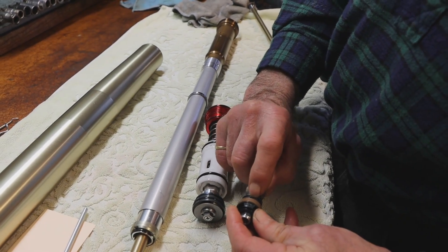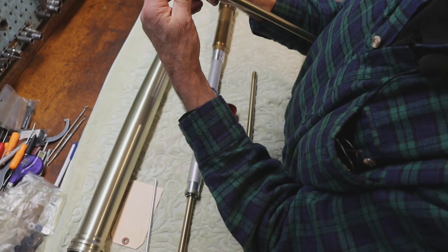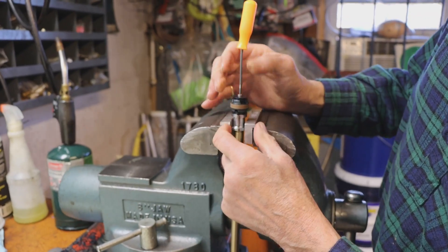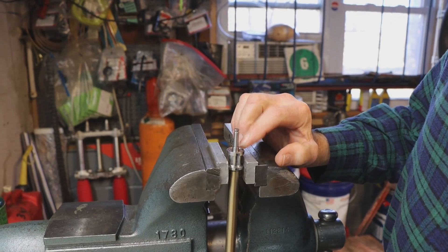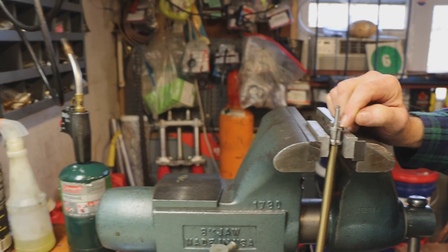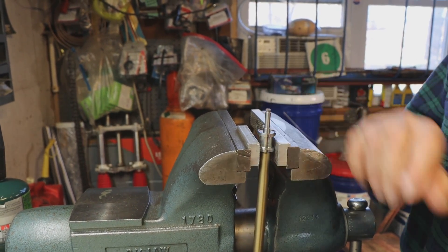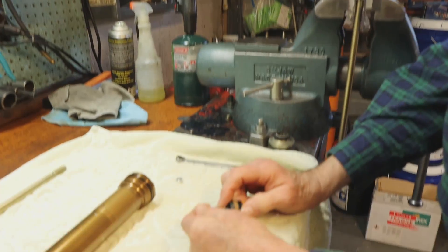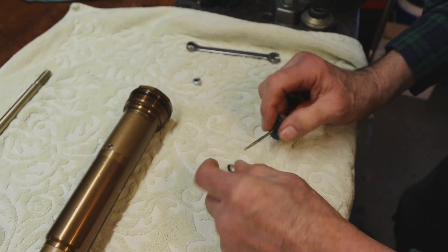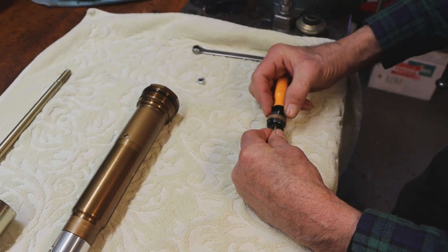So we see the trampoline style, and now we're going to look at this one where we have made some changes. You can see there's some room for the valving shims to open freely and let oil pass more easily. We removed the nut that holds it together, so the flexible valving shims can move up and down on the shaft — and this is a cupped item. In the standard configuration, there are even valving shims that limit how much the negative valve stack can move. What we do is replace that with a bevel spring or bevel washer and remove some of the valving shims, so we have a little bit more free movement. All of this is done at the same time with changes to the rebound piston assembly.